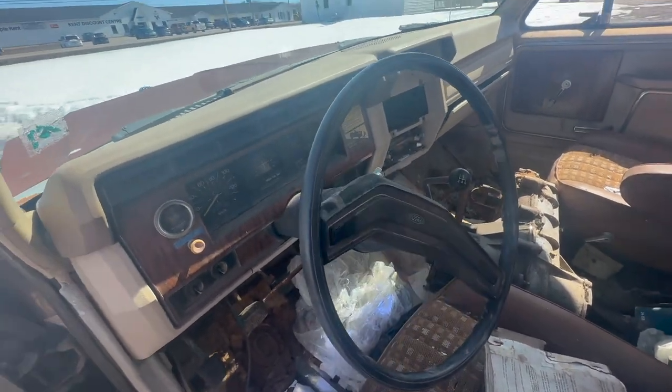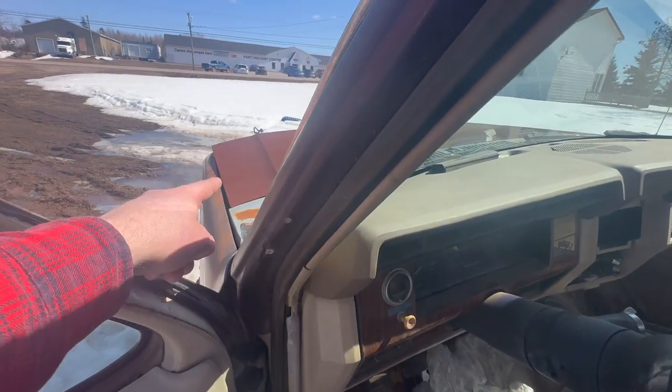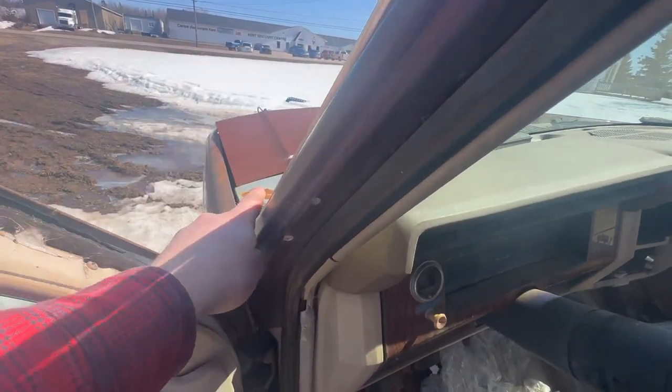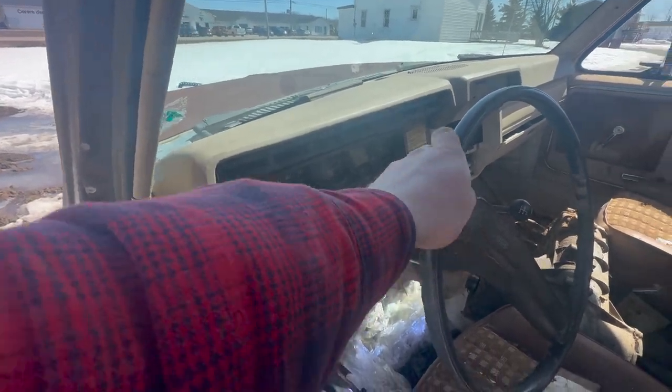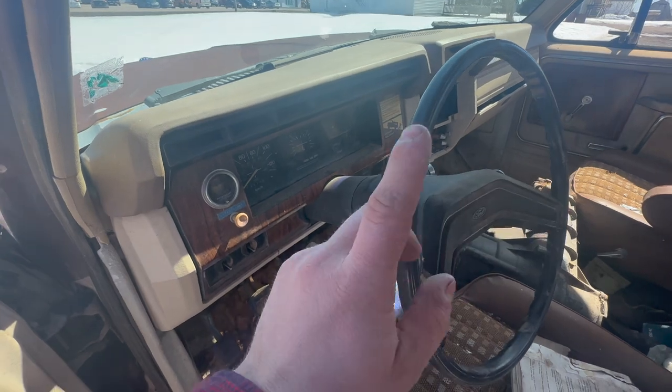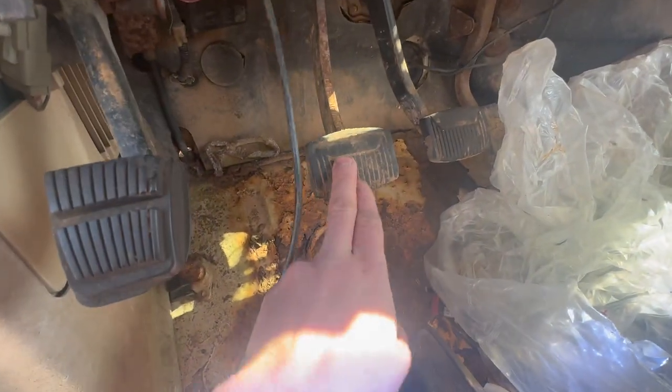Yeah, that's not supposed to do that. There's something going on in the column. Most likely it's because of that blown out, rusted, seized steering box over there. There's this little piece of rubber in between these columns, and you can rip that guy right out. So she's done. Another one, I already know this fella's done.